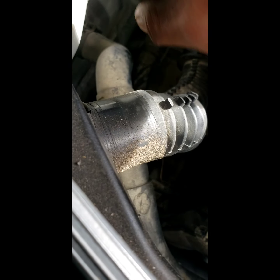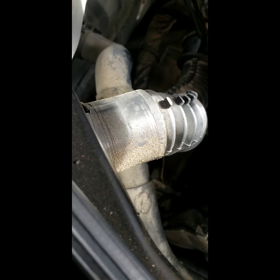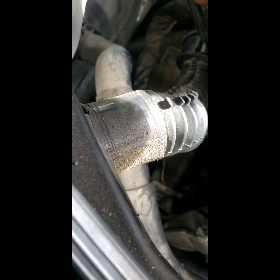This could be that the spark plugs themselves - actually found out that I have one bad coil pack and it's causing all of them to show misfire. And it's just a bad self-diagnostic system on this thing.